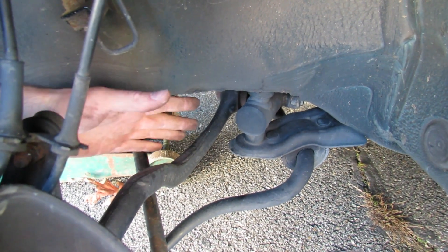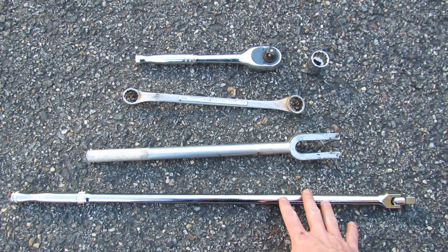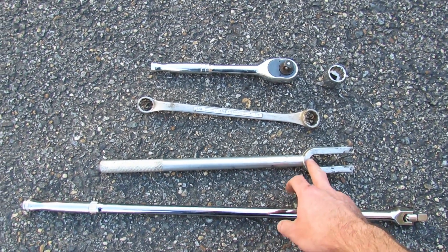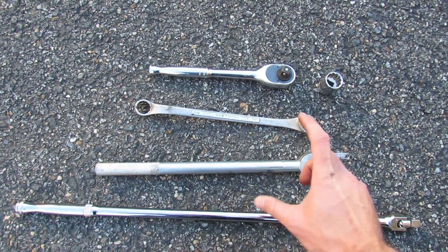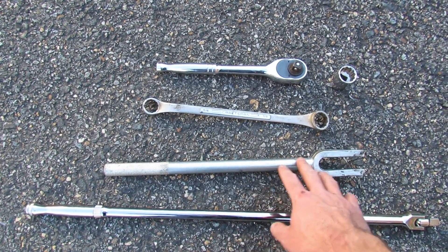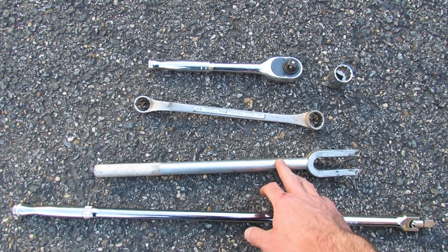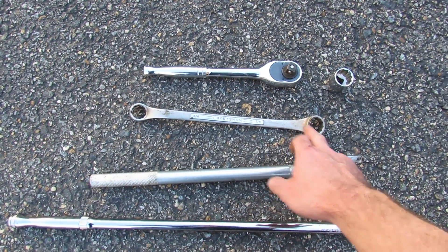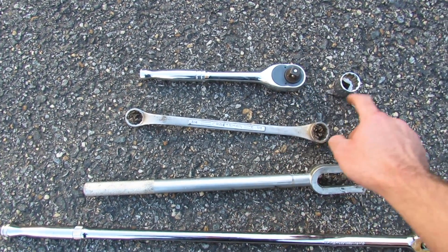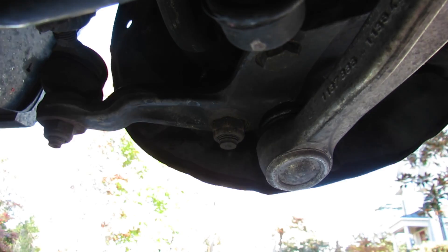These are all the tools you'll need for this job. I highly recommend using a breaker bar with a half-inch drive — these bolts are going to be stuck on. You'll also need a ball joint removal tool of some variety; this is the kind that you wedge in and hammer in. You can also use the press ones where you tighten them up until the joint pops out — this is probably going to be more effective here because there's a lot more shock you're exerting on the joint, and these joints are especially hard to get undone. You'll also need a 22mm wrench — this is a 7/8, which is the direct conversion — and a half-inch drive 22mm socket. That's all you need.